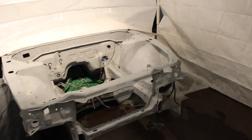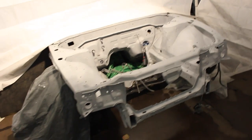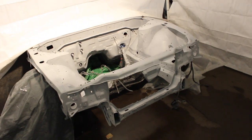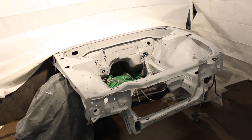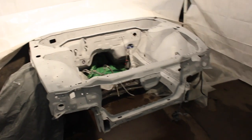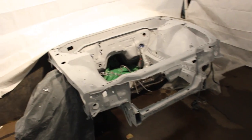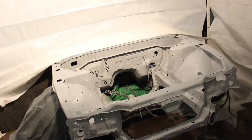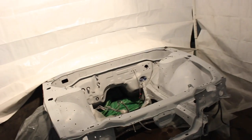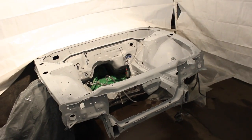Once this is done we can go ahead and start smashing everything together slowly piece by piece and get this thing on the road. You have no idea how pumped I am to drive this again, especially with the amount of power. This is going to be the third year I've owned the car. It was a stock motor setup — well a little modified: RB25 turbo on RB20 motor, it made 249 to the wheels. Anyway we're going to start mixing some paint; everything is wiped down, we'll use a tack rag, get everything as clean as we can and mask off what we don't want painted.